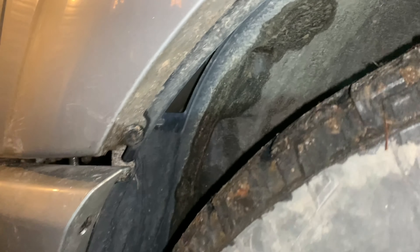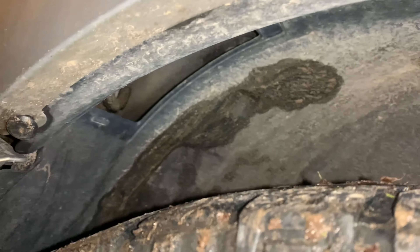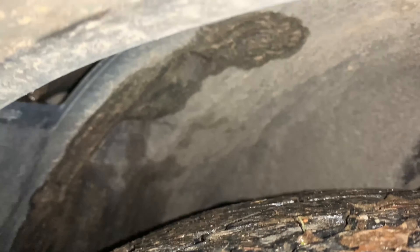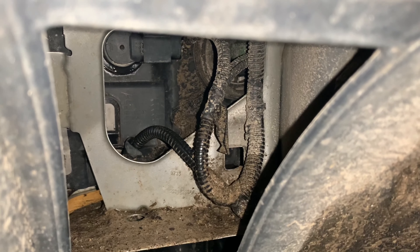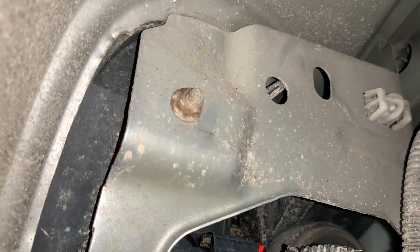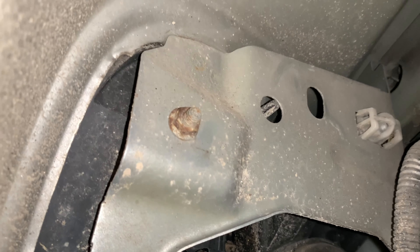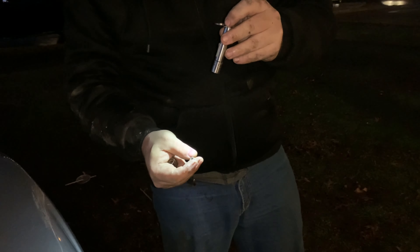The next step is under the wheel well - usually there's a door right there. Move that door up and out of the way and you're gonna need access to the wheel well. There is a nut on a bolt in there that we're gonna have to take off. Here is inside the secret door - the bolt is right there, and I'm gonna have to take that bolt out so I can remove the headlight.